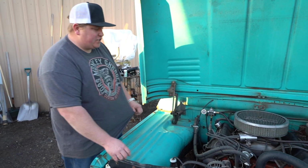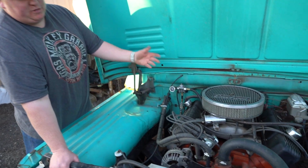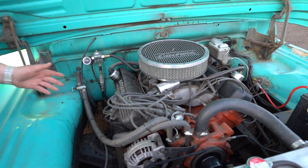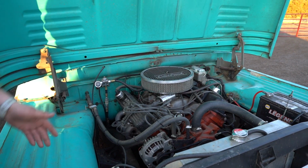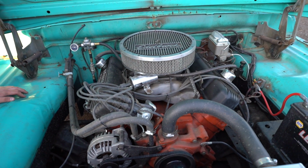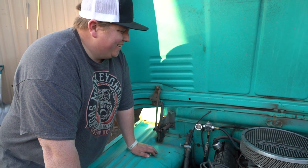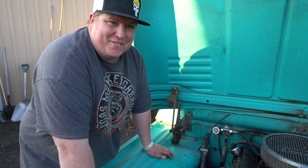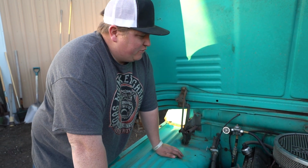The transmission backing this up is kind of hard to find. The transmission itself isn't, but the bell housing is. It's a truck MP435 transmission, so it's got a truck big block bell housing and flywheel and clutch. And that I actually ended up finding from a donor truck. And all of that is stock. I paid $50 for the transmission. So I do want to go a couple different routes, but I really admire the price of these MP435s. They're dirt cheap. And it's a two-wheel drive transmission.